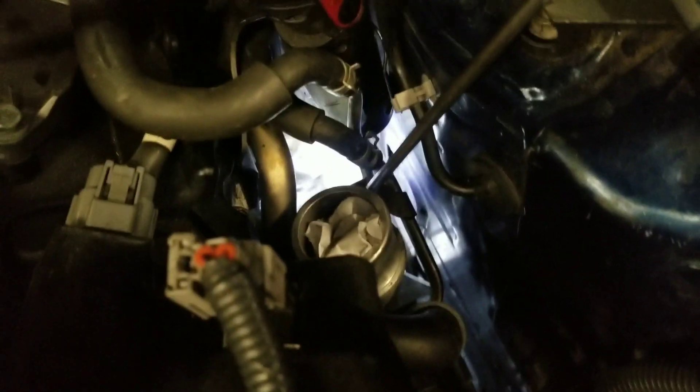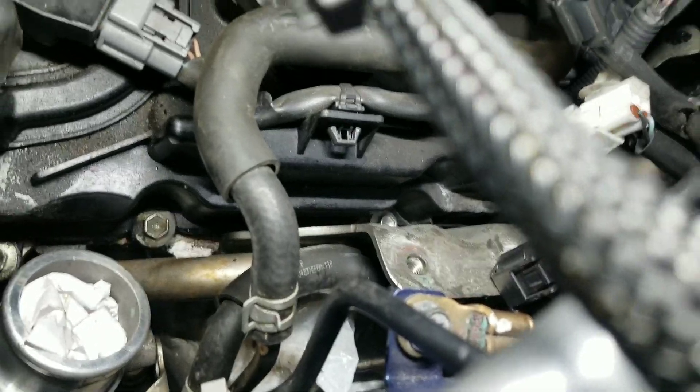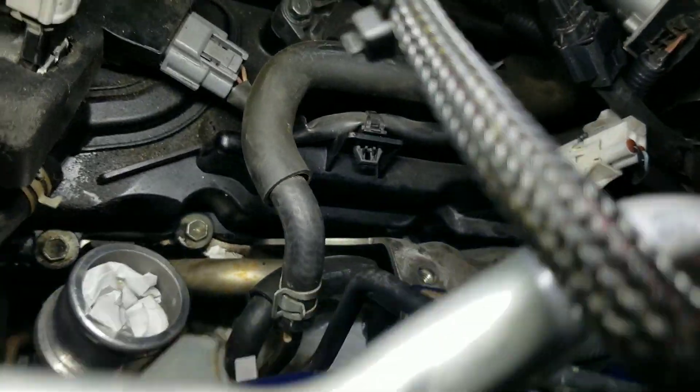That's the feed line. Yeah, that's the oil line right there. It's the gasket between — so that's pretty much the gasket for the cold side, but I'm on the hot side that's leaking. Let me get a better light. Yeah, you're right — it's leaking from the side. Man, that stinks.